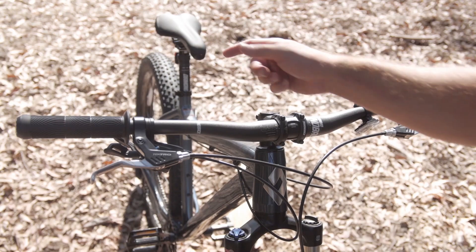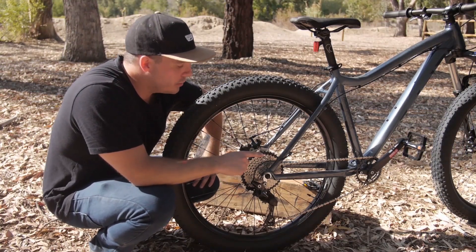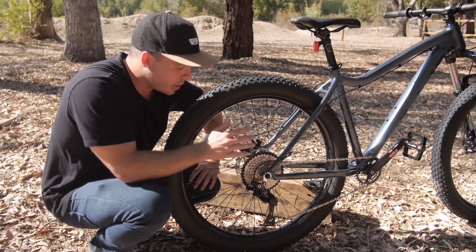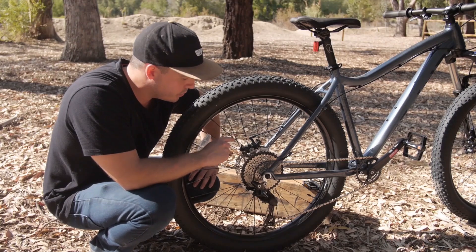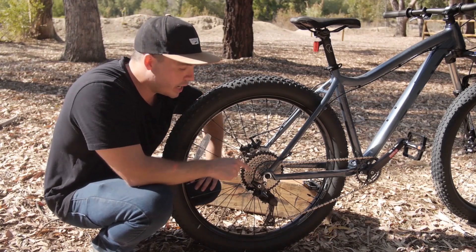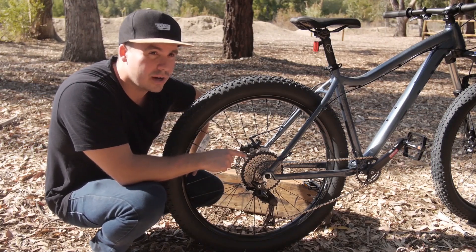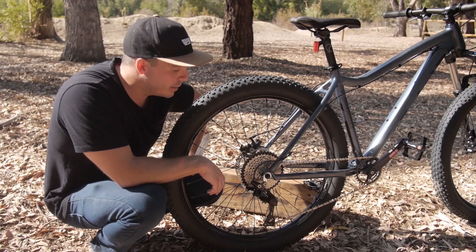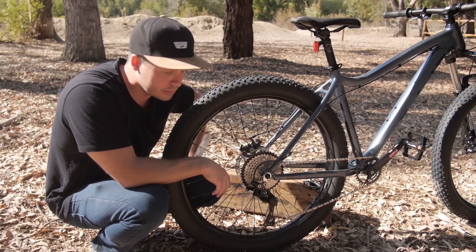The Mason 1 is running a 1x10 drivetrain. It's got a 32-tooth sprocket up front and the Shimano HG500 10-speed cog set in the rear, with a range from 11 to 42 — pretty good range, should be plenty for my cousin to climb the hills around here. It's got the Tektro Ares mechanical disc brake in the rear, just like the front, and the Shimano M6000 Deore rear derailleur. It's got a boost hub in the rear and a 9mm quick release — not the 12mm through axle like the Mason 2. There's more stiffness to gain with the 12mm through axle, but I still think this bike is definitely worthy of upgrades in the future.